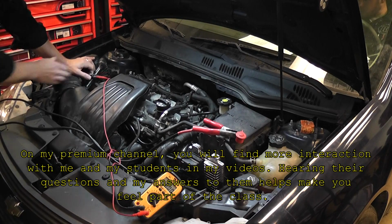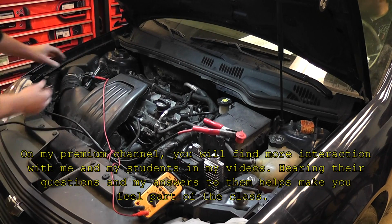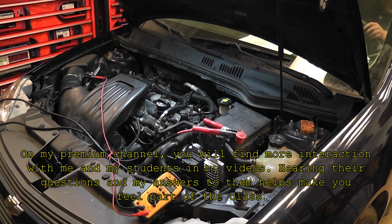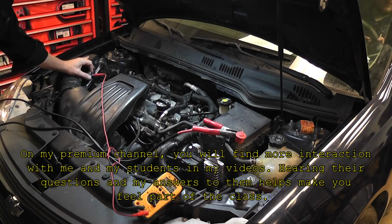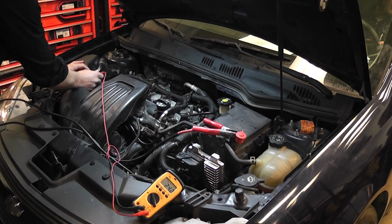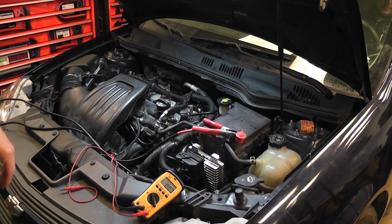I'm going to unplug this and show you my mass airflow signal wire unplugged. What are we seeing on that wire? You guys see it? 5. I just unplugged the mass airflow sensor, and that was missing as well. That's plugged in. That voltage is being manipulated there. All right, so our reference circuit's fixed.